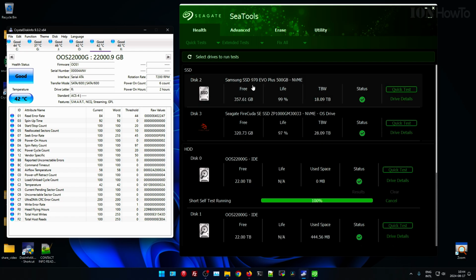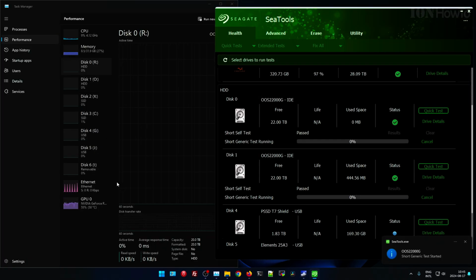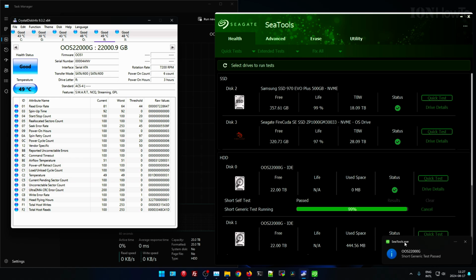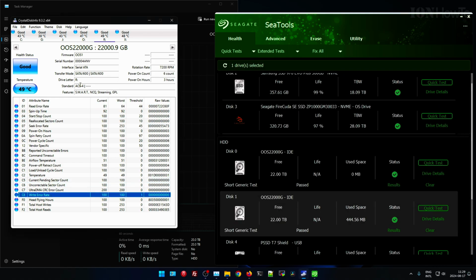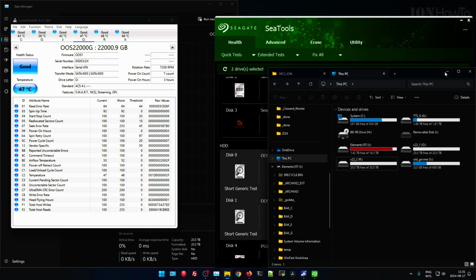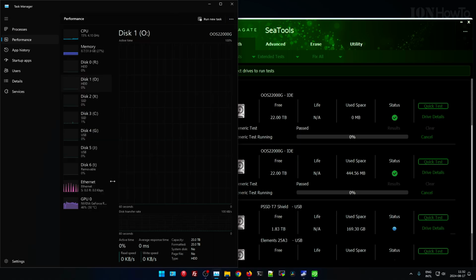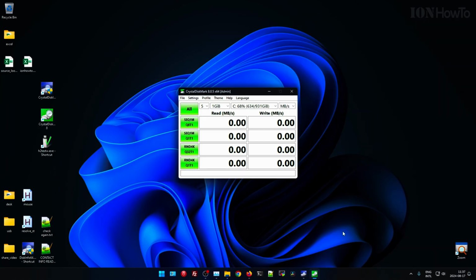These are white label Seagate Exos X22 22TB, meaning they are even worse than recertified refurbished, because they didn't even put the Seagate brand on them. But they are working. I tested them. I did even the extended tests in Seagate SeaTools, but you have to know that the serial number will not be registered on the Seagate website. It's like it doesn't exist, so that's something to know.